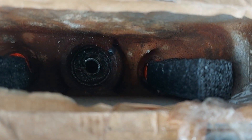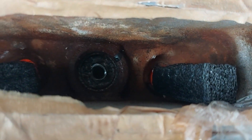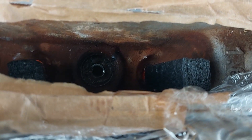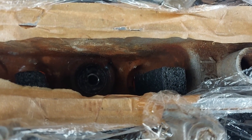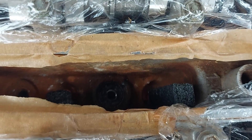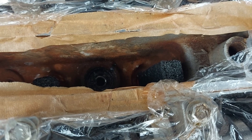This plug here — the freeze plug, antifrost plug, or core plug depending on what it's called in your neighbourhood — I have already drilled a hole into it because I was going to try to get it out using a metric or screw thread, like a bearing puller, to pull it out. But this doesn't work, and I wanted to avoid damaging the aluminium by pulling a steel plug against it.